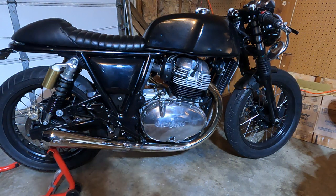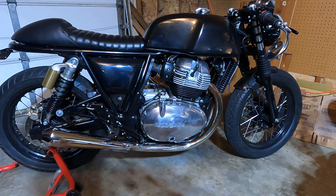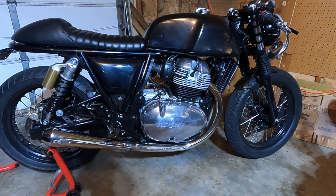That's really the main reason for this kit. I'm also hoping that switching from the airbox setup to pod filters will get better air. The way the bike works now: air comes in around the side panels into a compartment, gets sucked into a filter, then into the airbox, then pushed through two tubes into the two air intakes. It seems like quite a circuitous route. If I can just make air go filter-to-intake directly, that would be easier for the engine to suck in — the airbox isn't pushing air, it's just another thing in the way.